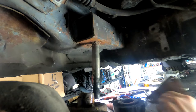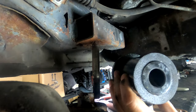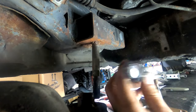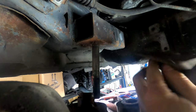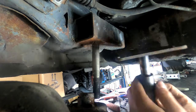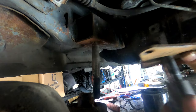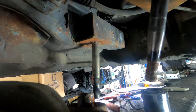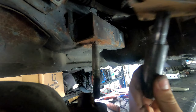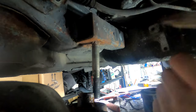The factory mounts — here are the sleeves that came with the bushings I explained in an earlier video. What's nice about these is they're actually tapered on one side, so when it's mounted up here, this sleeve and bushing is a really tight fit on the factory stud. The factory stud is thick and then tapers down, and the bushing is tapered so it only fits one way, ensuring a nice tight fit.